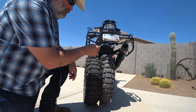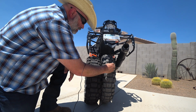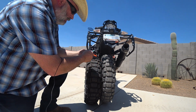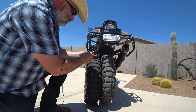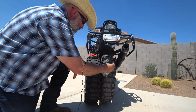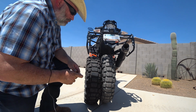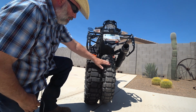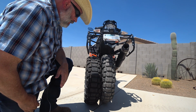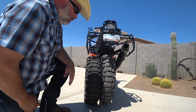we are at 10 millimeters. So the new tire, and this has only got about 20 miles on it, just enough to make sure the bead's set, we're probably around 16 millimeters, somewhere around there. So it's about a 5 millimeter difference between where it was and where I started having issues with traction. Like I said, I could probably continue on a little while longer, but I would not recommend going all the way down to the wear bar.